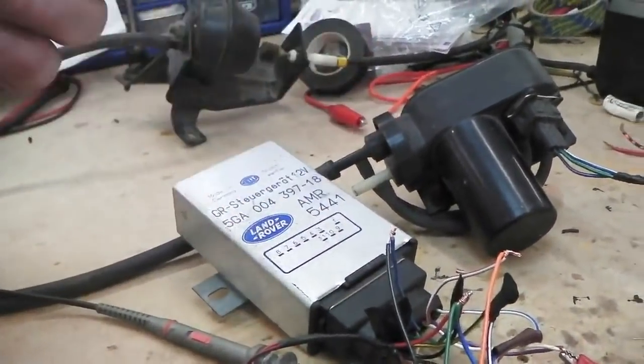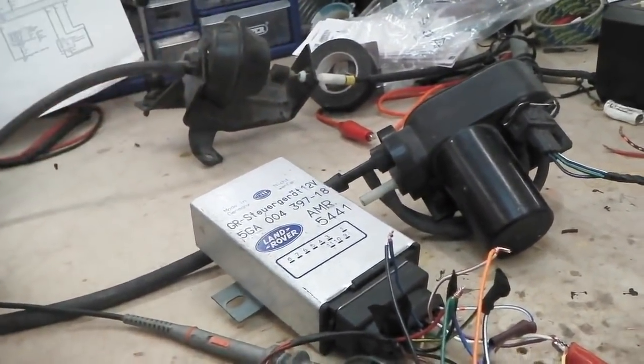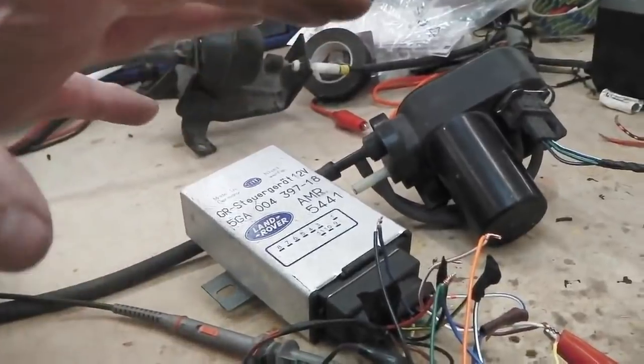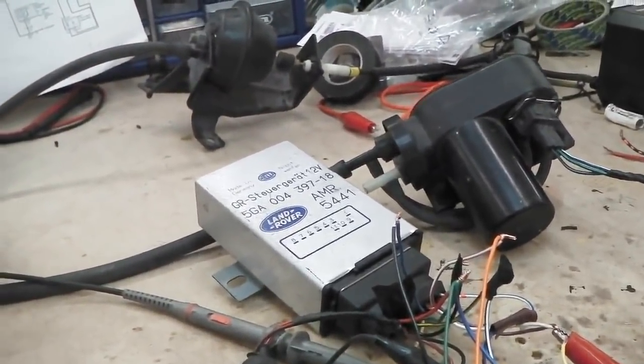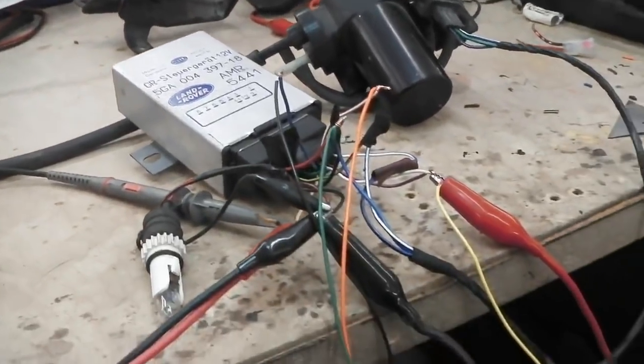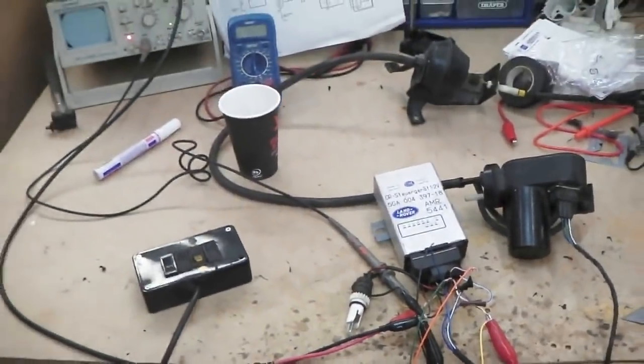You can turn the board over. Be very careful with your heat gun. As you just see the solder start to melt, then lay back. Be really careful. It's a bit of a gamble, but if it's broken, there's nothing to lose. You can do that, and I had a faulty one which I did that with, and it repaired it. That's it, we're done. Cruise is in, on the bench, working,